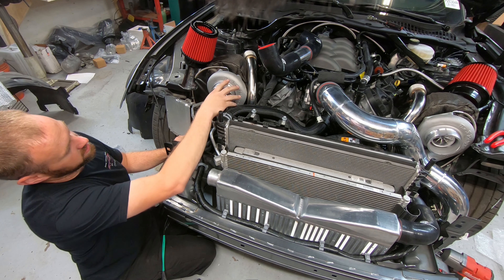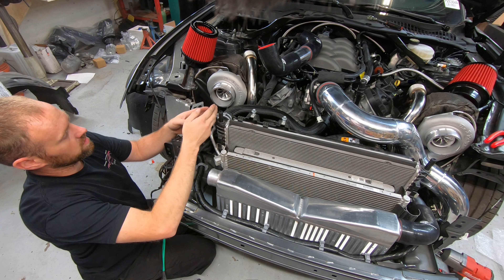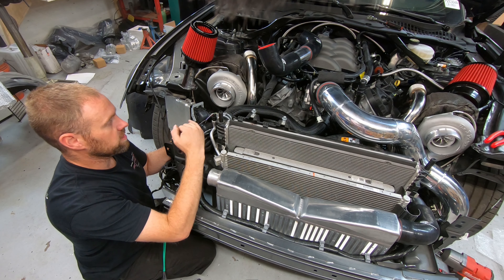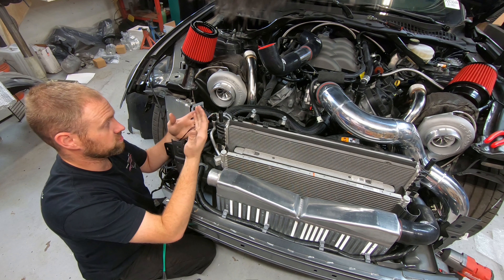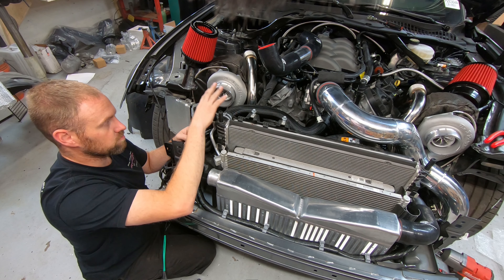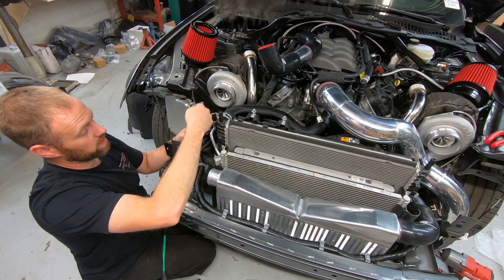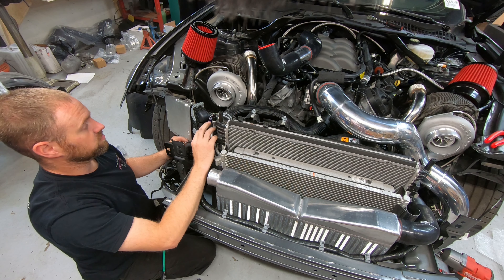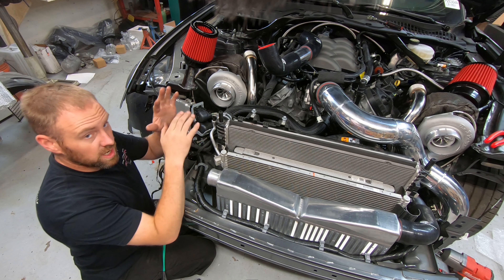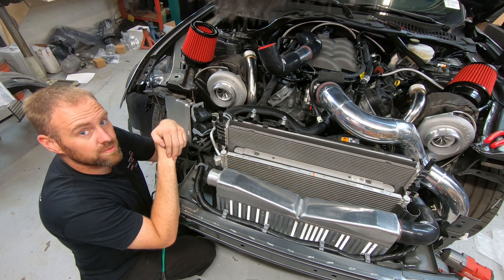Those were the two wires I had to extend. If I put this guy here, you can see it's in the way of that. This guy would like to run a filter, so I'm going to have to come up with some kind of solution where I create an inline pipe out of four-inch aluminum elbow — I may have to cut a chunk of it out and weld a humped area into it so it can actually function properly. This is only a 55 millimeter turbo, so the compressor wheel inside diameter is much smaller than the four-inch pipe, and because of that I can get away with putting a hump there without affecting airflow too badly. As long as I keep the hump to a minimum, it should be fine.